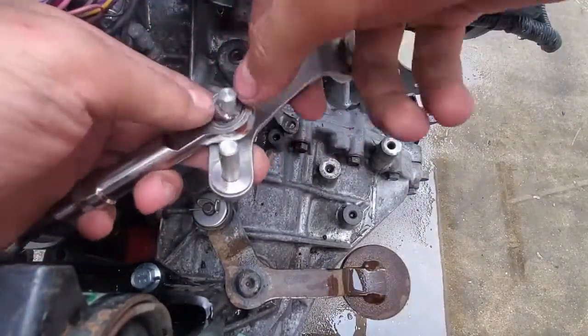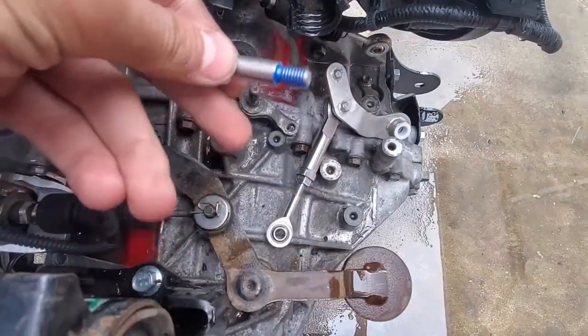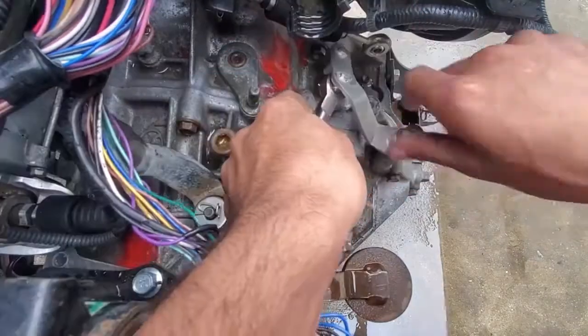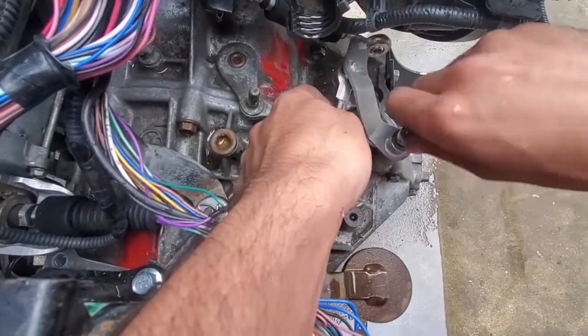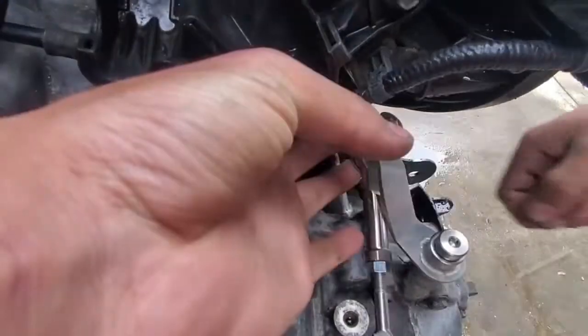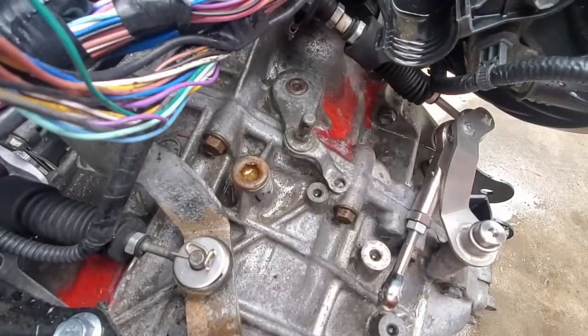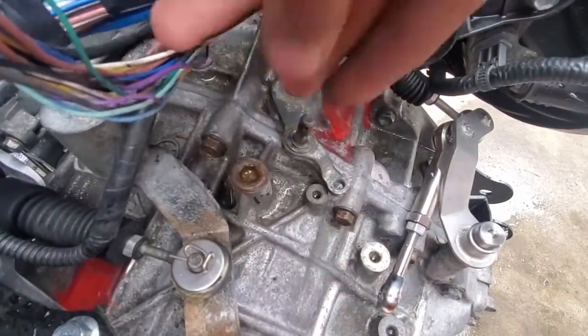There will be play in the assembly, but that's normal. This piece now bolts onto the transmission. This bolt does need lock tight as there will always be a force undoing the bolt every time you shift. Now the chassis shift line gets connected to the mechanism, same washer pattern as before. The mechanism is completed by finally installing the arm onto the transmission.